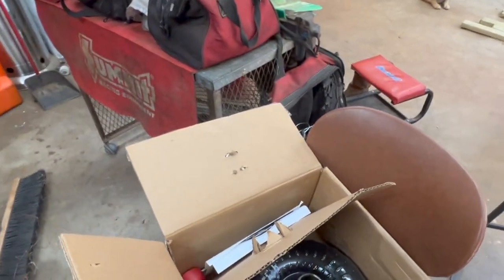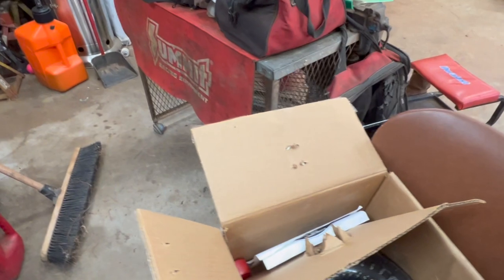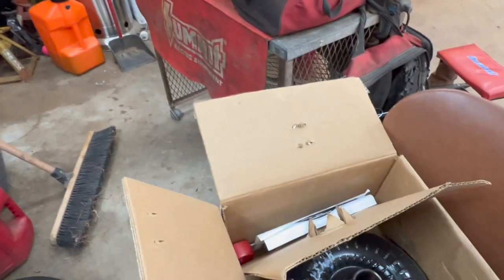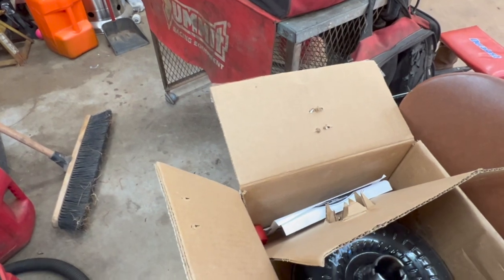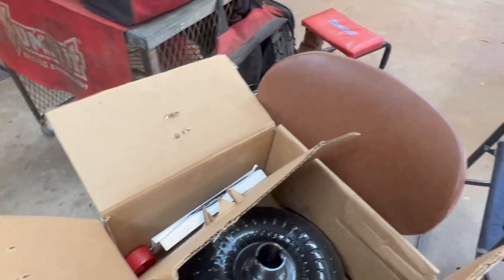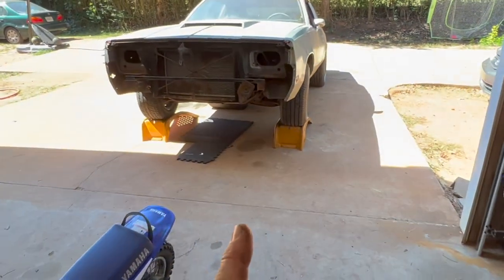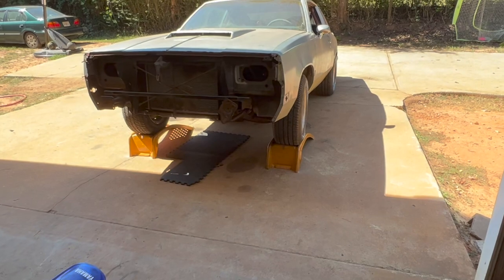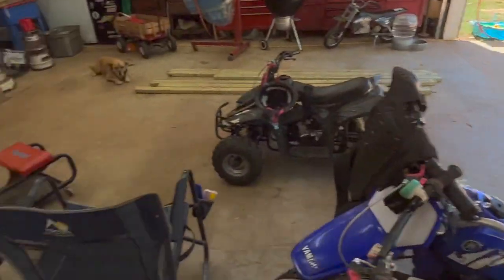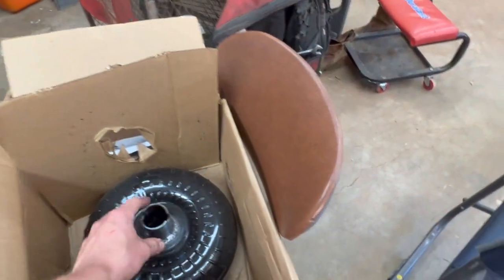I got a family function to deal with but we're going to put some ATF fluid in it. I didn't buy the super nice stuff — this should be just fine. But this transmission in theory shouldn't last too long behind this 403. It shifts kind of early, so I think that's going to be our next hurdle. About the time you're midway into a decent pull, it just shifts into second — that's no good.